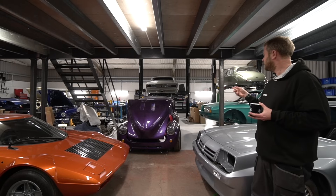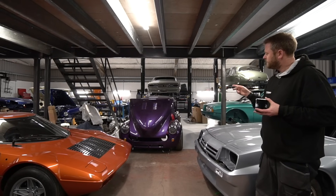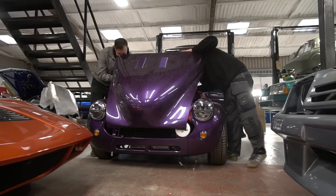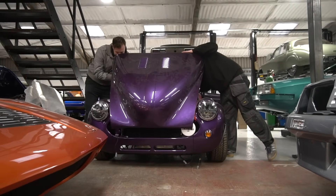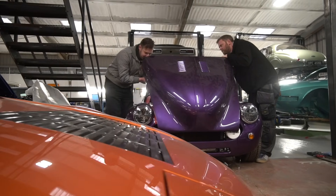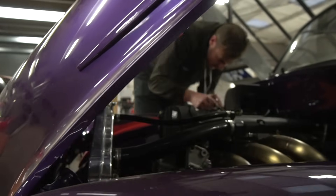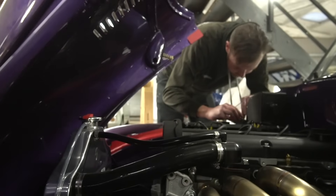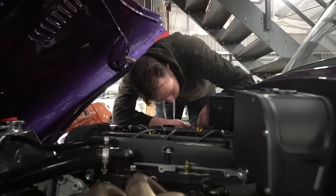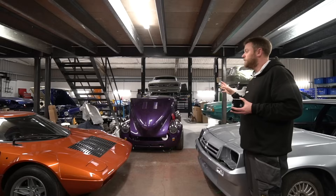Adam's just doing some finessing work on the bonnet latches. We noticed an issue where the pin on the latch goes into the sliding receptacle - because there's nothing to locate it underneath, the bonnet can move around and unlatch itself. So we're doing a little circular guide underneath the latch part so that once it's gone all the way through and latched, it's held dead fixed and can't move around.